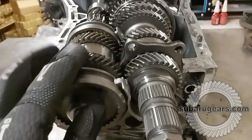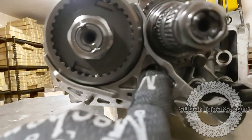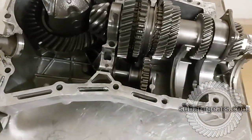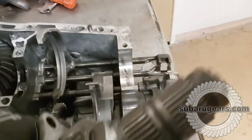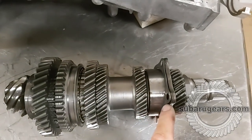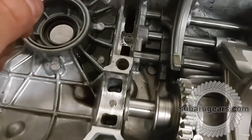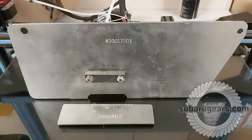To continue taking the gear set out so we can remove the differential, we need to undo one retaining bolt here and get a socket through to undo the second retaining bolt. To remove those two bolts we'll take the input shaft out — transmission is in neutral. Notice there is a pin here that needs to align with the hole on the front bearing when you reassemble it. We should now be able to lift the driven gear shaft out as well, letting us remove the differential. We're going to put the driven gear shaft back in the case and measure what the pinion depth was originally. With one shim installed, this hole has to line up with the pin in the case — notice the hole is towards the end of the pinion shaft.